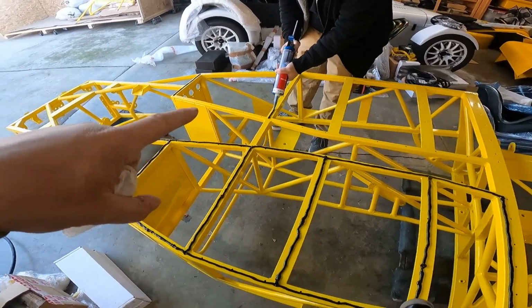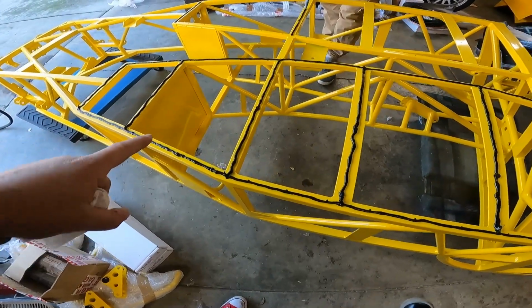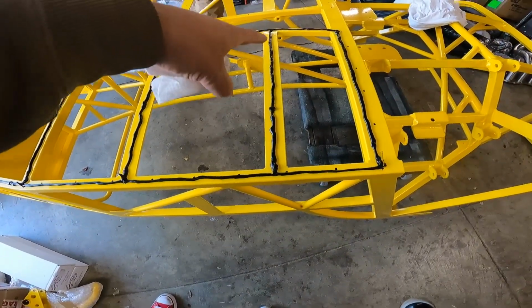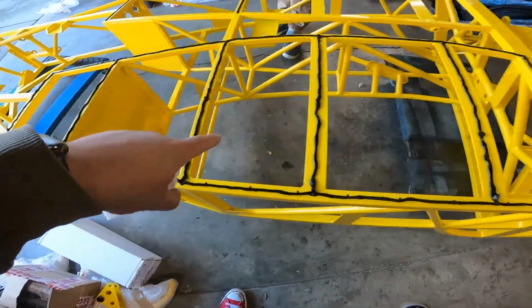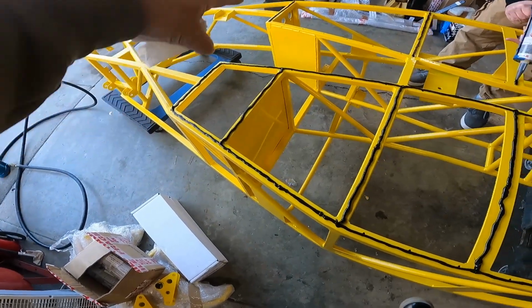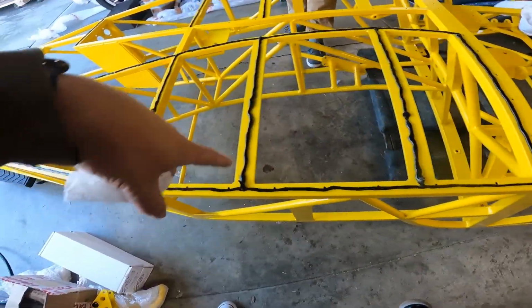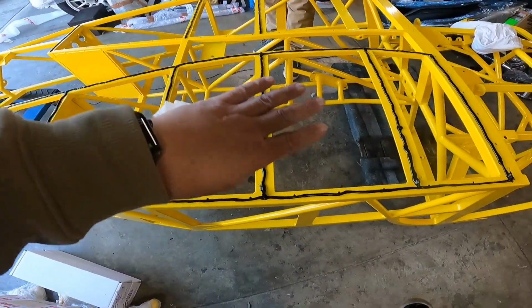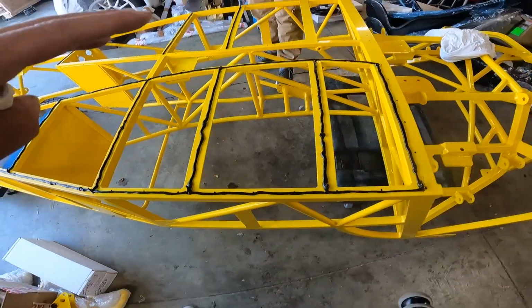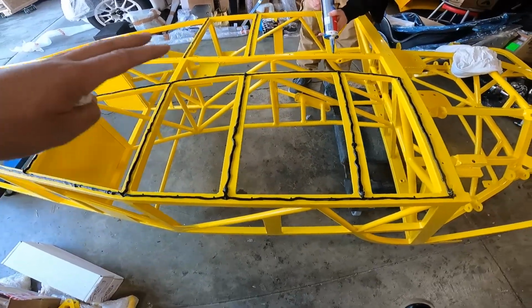While Sean is applying the bead to the floor pan area on his side of the chassis, something he mentioned that I want to bring up is here on these cross braces, while not basically structural, putting some of that sealant on these cross beams will keep the panel from rattling here in the middle area. So you want to lay a bead all around the perimeter where the pan will seal, but you also want to do it here across the middle. And what that does is it'll bond the panel into the middle of the floor area, and it'll help reduce some of the rattles. Not that this car is going to be quiet, but every little bit helps for these kind of rattles all around the chassis.